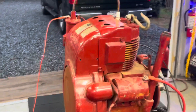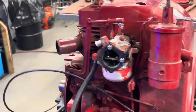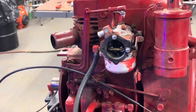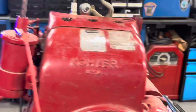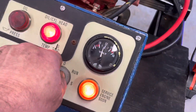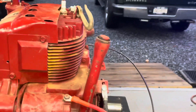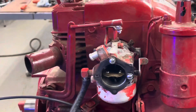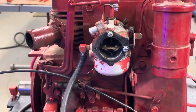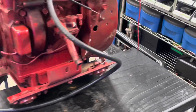It runs pretty good. What I don't know is if it's an operator problem or if it's giving it too much pressure — I think I'm just going to throw a regulator in it. So yeah, it works pretty good. Just got to get that fuel pump figured out a little more, or figure out if it's actually the carburetor, because I really didn't clean it. I just kind of took the bowl off, wiped it out, and it didn't look too bad so I put it back together. It could be the carburetor — the needle could actually be sticking in the needle seat — but we'll figure that out.